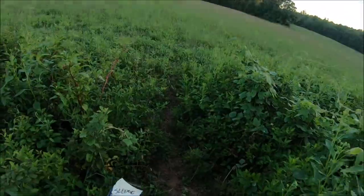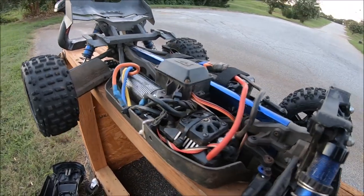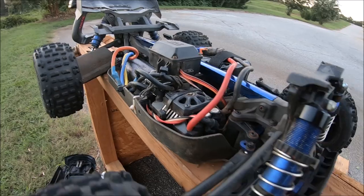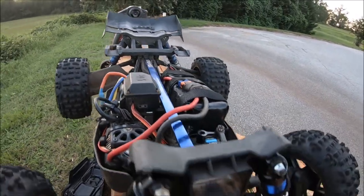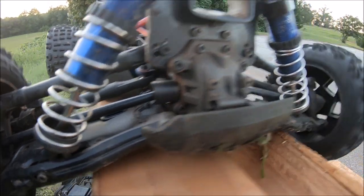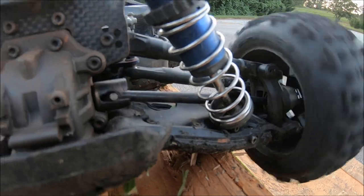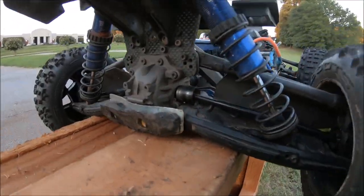We got it corrected. All right, guys, that's gonna be it for the first test of the M2C drive shafts. This thing's got a bad diff in it, so I'm off to go through it. I think it's the back one, but we'll just have to see. The diffs in this thing have held up since I bought the truck, so I'm pretty impressed they've held up this far. Just a quick shot of the drive shafts, still perfectly straight. The pins look good. And this thing is taking a complete hammering. Super big airs, big rolls, and everything is perfect.